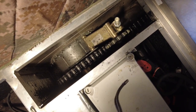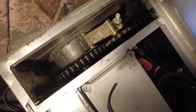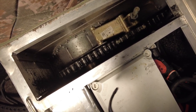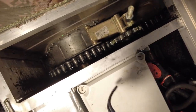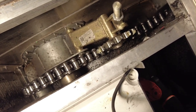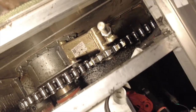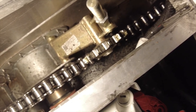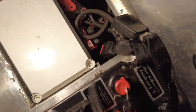This is the passenger front side chain tensioner mechanism — much easier because there are no hydraulic lines here, so there's a lot more room. It's much simpler: this one you can push down, as you can see right there, and that's what keeps the chain tight. It's a little different than the other side but much simpler, and that one is just fine.